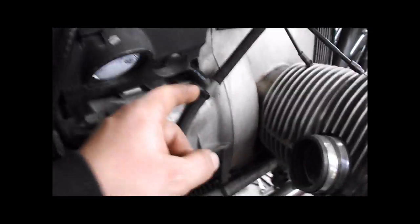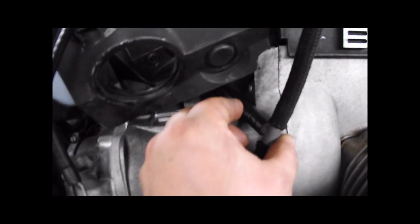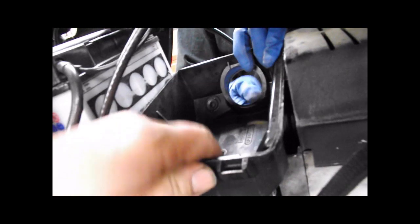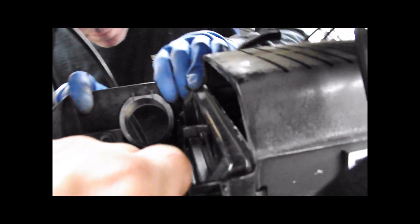Replace this crossover hose and try to use the regular rubber fuel injection line stuff instead of the braided cloth hose. Let's see, anyway. We have our plugs installed here, and once we get this lined up, there we go. You can pull this rubber in the front and after. We also replaced this grommet since we're doing away with that vacuum port.